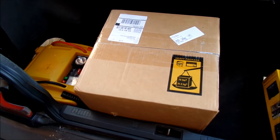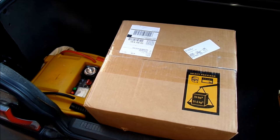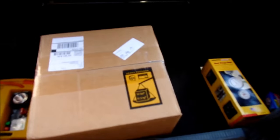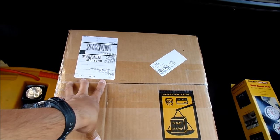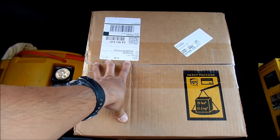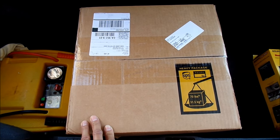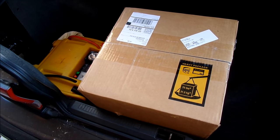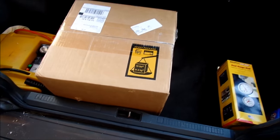What the hell is this? I've been driving around with this the whole time. Oh, you know what this is? This is a box full of suspension parts for the Eclipse. I was gonna work on it at my other house. Let me get this out of the car first — it's really heavy. What's in this box is all the arms for the front of a second-gen Eclipse — the upper and lower and all that good stuff. I'm sure one of the ball joints is worn out on my second-gen. This is why my steering wheel shakes, so I said, what the hell, just replace them all. It's got more than 200,000 plus miles on it, so it's about time I replaced them.